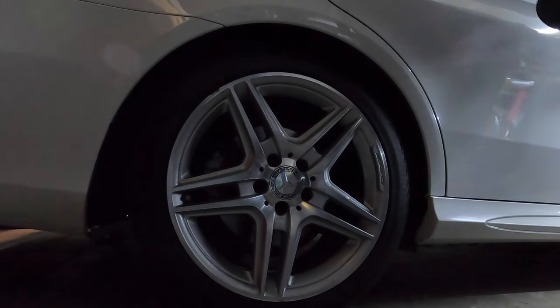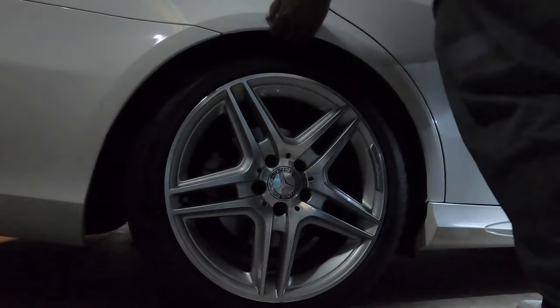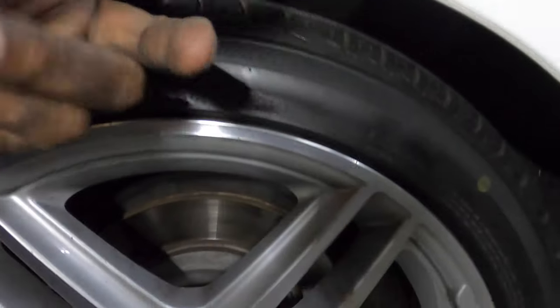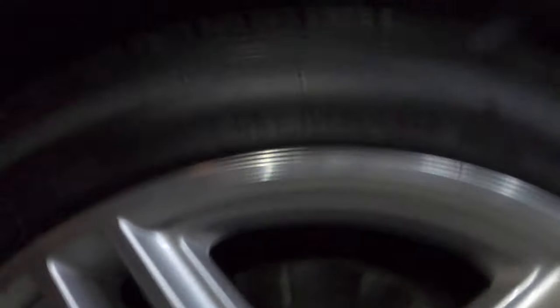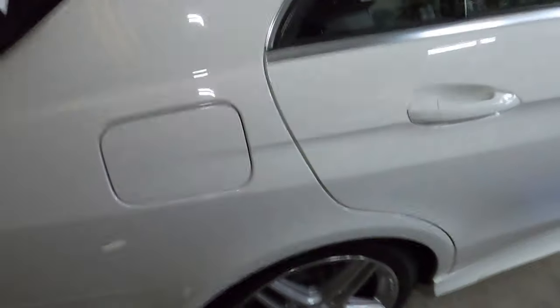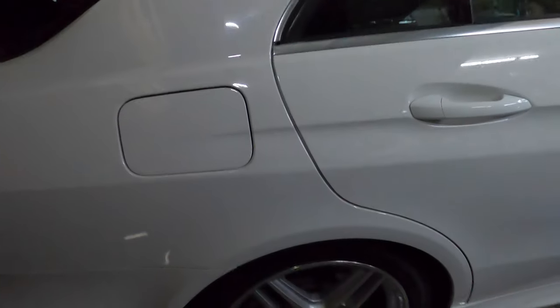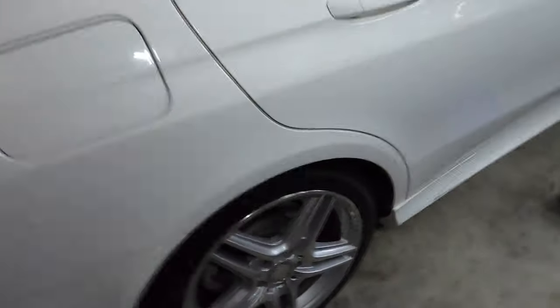All right, so yeah, with the rear spring perch maxed out, that's about, really, that's probably not even a finger, to be honest with you. That's like right there. It might be like 3/4 of a finger. But, so if you are using yellows on a 350, and this is where you want it, go ahead and max them out. Because otherwise, you ain't going to get what you're looking for. Woo! All right, we got to do a tool inventory, and we'll be back after that.